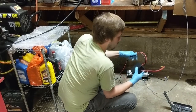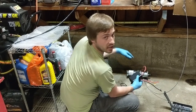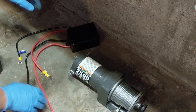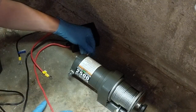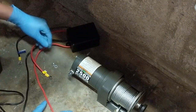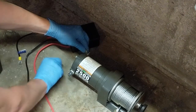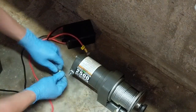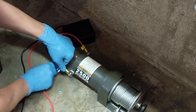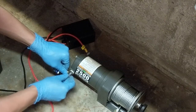They didn't give me quite enough wire from the control box to easily mount it to some wood, but that's okay — I'll probably just stash it right behind the winch. Attaching the wiring to the winch itself is very straightforward. The terminals are very clearly marked with red and black. You're just going to attach red to red and black to black — in this case white, but you can assume that's the negative because the red is definitely positive.